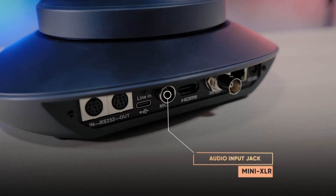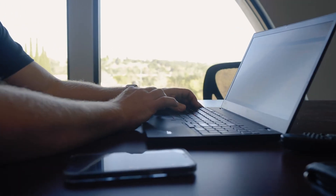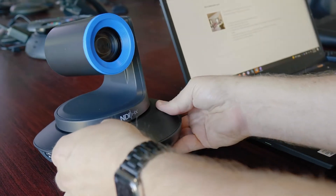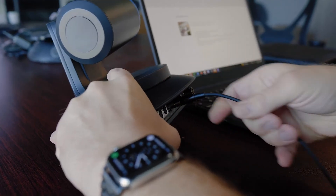The biggest change is in the form of this mini XLR on the back panel of the camera. There's still the 3.5mm input, but the inclusion of a mini XLR allows users to rethink how they treat audio in their NDI workflows. Imagine sending a PTZ3 camera down to the CEO's office — rather than also needing to send a full soundboard to deal with audio, you only need to plug in your mic with the included adapter and the audio will be embedded into the NDI stream in sync to its final destination.